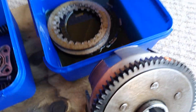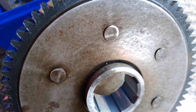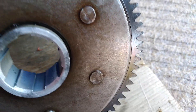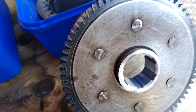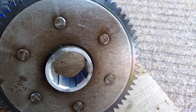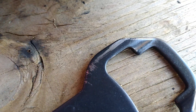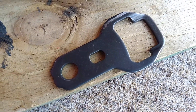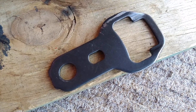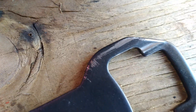This is the back of my clutch basket and if you look carefully you'll see that as it's been spinning around, these rivets here have been catching ever so slightly — still enough to make a noise. The noise has been the rivet hitting the top of the clutch selector, the gear selector shifter plate, just in this little area here — not hitting it by much but certainly creating that sound.